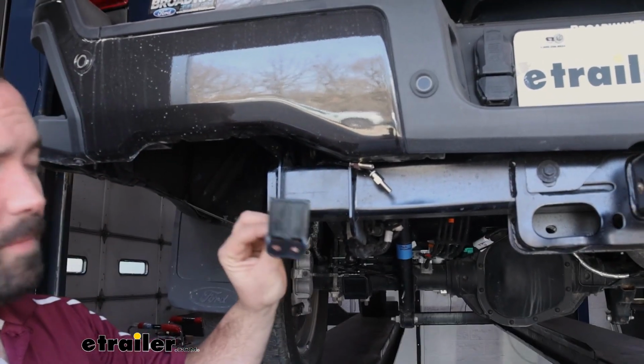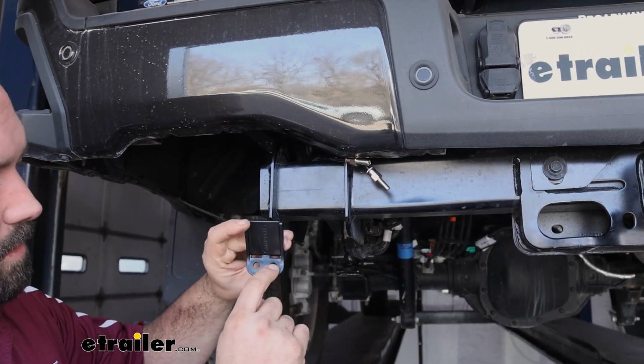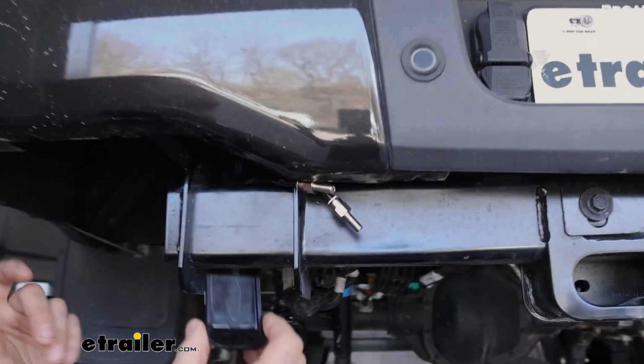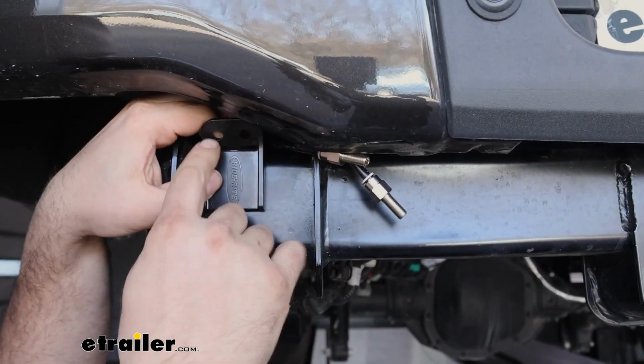And included in the kit is going to be this bracket, which is going to be really nice. You have obviously two sides for each Schrader valve, so you can have left and right. So make sure that you're running those accordingly to the bags. And this can mount up on the hitch wherever you really want it. I think I can do mine up here, and it's going to be a nice and clean look.